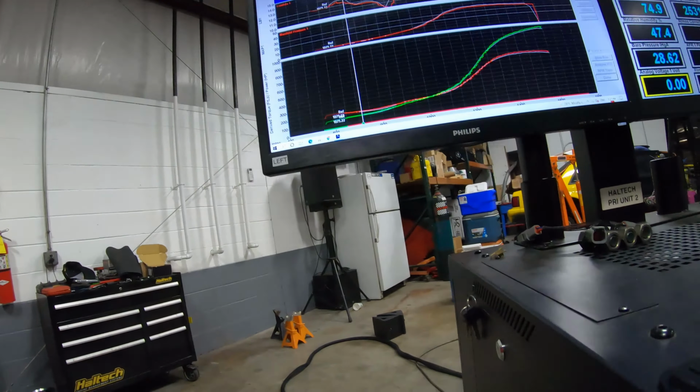Exact same horsepower, but 4 pounds less boost just because of the timing that we're giving it. The air intake temps are not changing at all. The intercooler is amazing. It's working great. So we are gonna give it 2 degrees more timing. Torque is hanging out around 600, being happy and loving life. So yeah, we're gonna put 2 more degrees in,